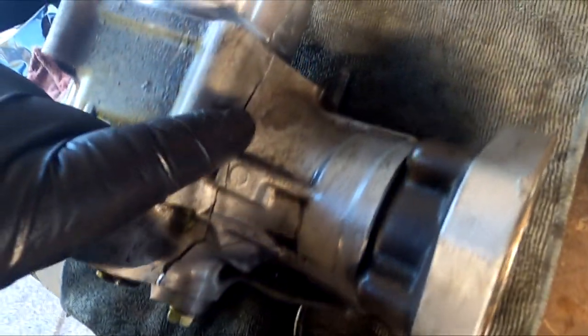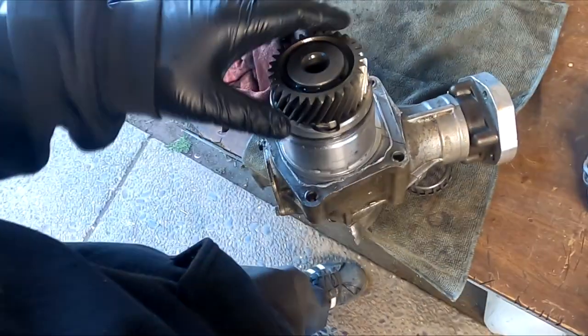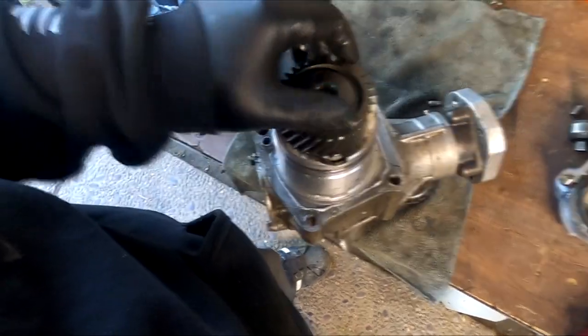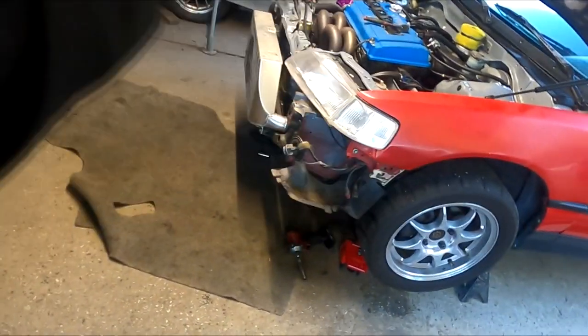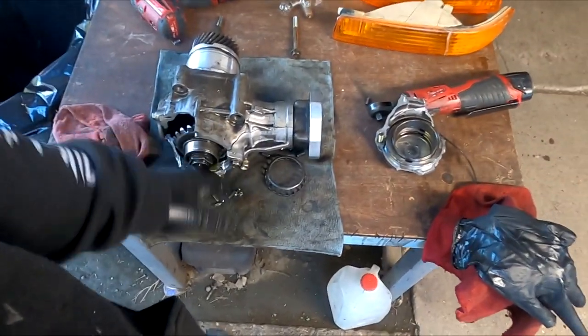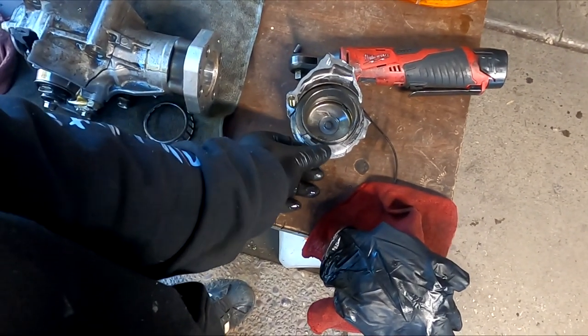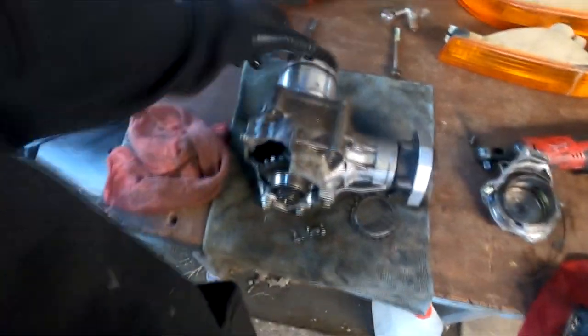Pretty much this case is cracked all the way to the front transfer gear. I've got a huge crack — crack is bad guys, do not do crack. The good thing is the gear that goes to the differential — nothing is broken. So I doubt anything has flung into the transmission, and I'm hoping my diff is good. Easy way to check is to put a flashlight in there, rotate the wheels and gear, and watch the diff teeth to see if anything is missing. If I can find all the pieces I'm pretty sure I can JB weld it back — as long as everything is within clearance we should be okay. Put a new o-ring and we should be good. Everything still spins, which is weird.